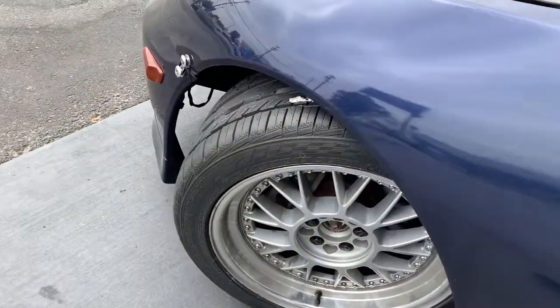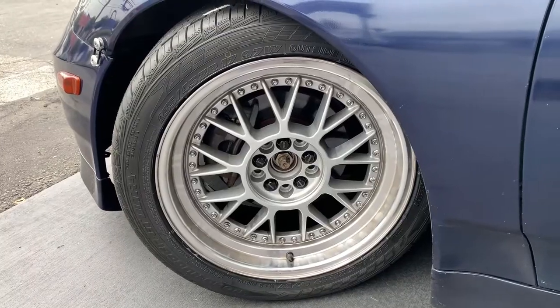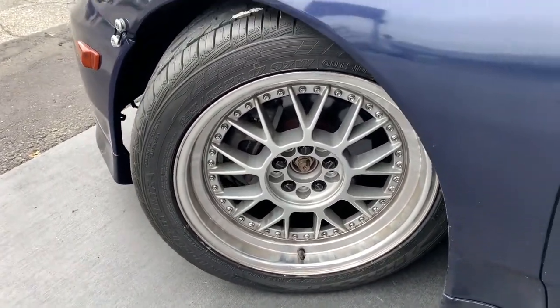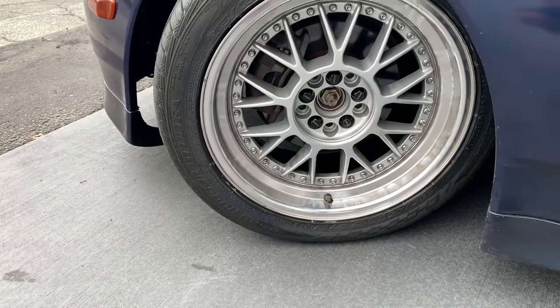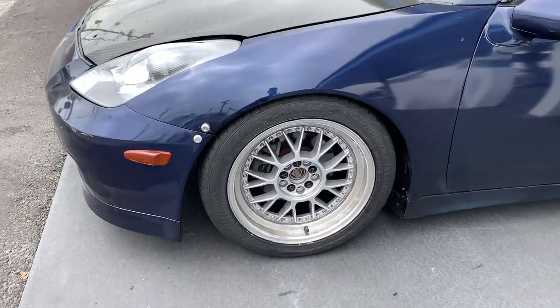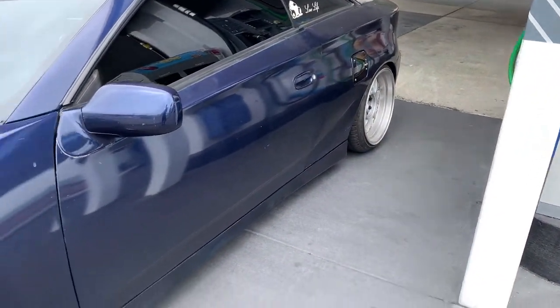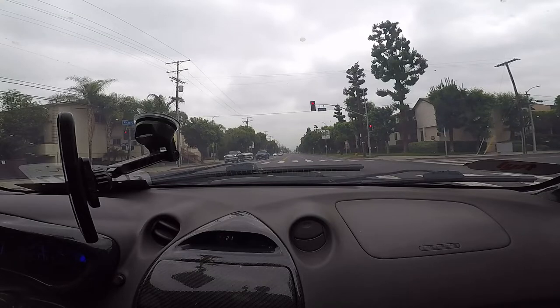I didn't want something really performance-oriented, but this is what they looked before with the stretch, and now this is what they look — no more stretch. Looks a little funky but I'm not into that whole stretching thing. The only reason I turned the wheel is because I was afraid I was gonna rub, but nah, I'm not rubbing. I could have gone 255s but I was scared I'd rub, so I went 235s. It looks better with the wheel straight, but I like function over looks. There's a little rubbing when I turn all the way left or right — I think I'm rubbing on the inner wall.